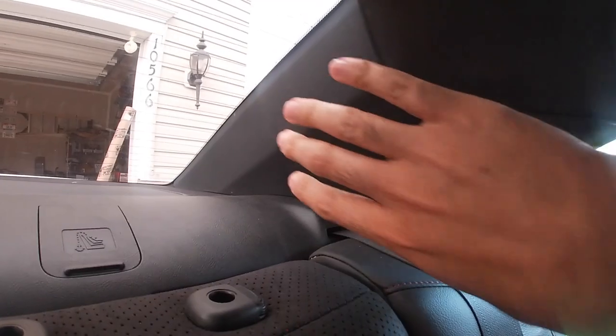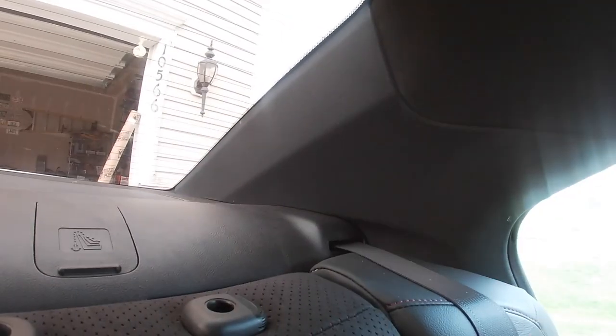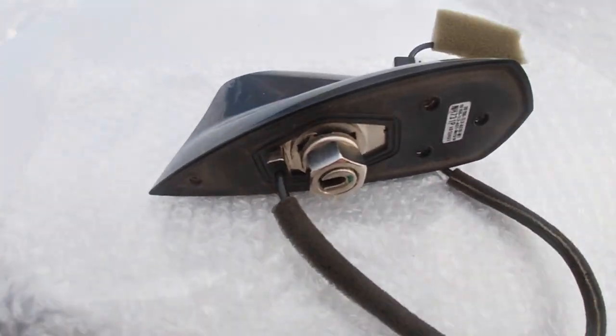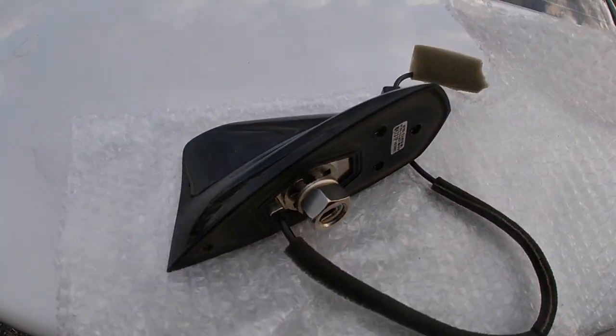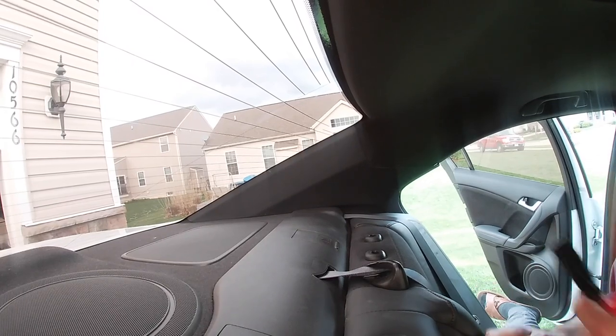I need to work with this pillar and take it out — be careful, there's an airbag behind it. There are attachments here, here, here, and down there. Once this comes out I can pull it down a little better and put a socket in here to unbolt it. If you go back out, you'll notice there is a bolt that I need to unbolt — there's that bolt.